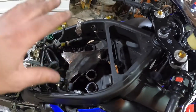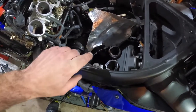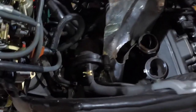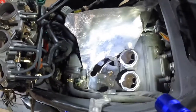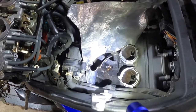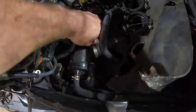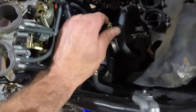This is a pain, but it is the easier way. I've heard of people taking out the thermostat to get in there, but taking the throttle bodies off gives me great access to where the bolts are on the starter. I can get to everything I need, then just wiggle the starter in — angle it in and push it into the engine. First I need to upsize the bolt hole on the cable, just need to make the hole slightly larger and then we'll be ready to rock and roll.